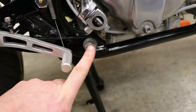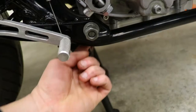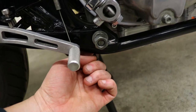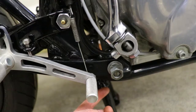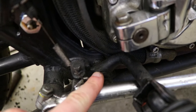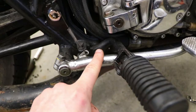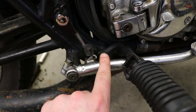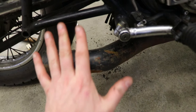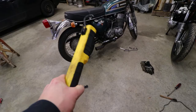I'm going to show you what we did on Jay's CB550 Cafe Racer project to make a bracket to support his exhaust system. Right where the factory foot peg mount would have been for the rider, we made a bracket that goes in between the engine casing and the gusset on the frame. There's a spacer there from the factory on his bike, and we basically machined down the spacer to accept the width of the bracket we welded onto his exhaust. I'm going to see if I can do something similar on my bike — I've already looked underneath and there is an engine bolt that carries right across here.